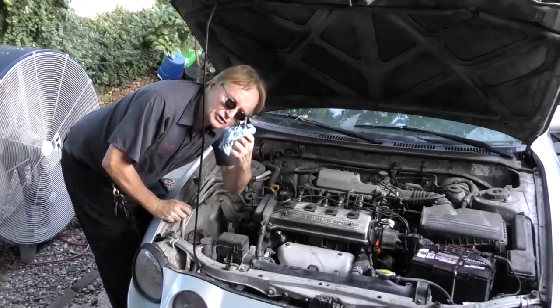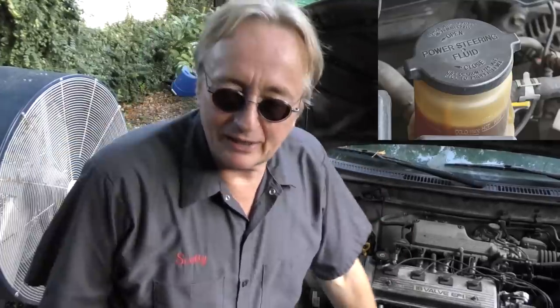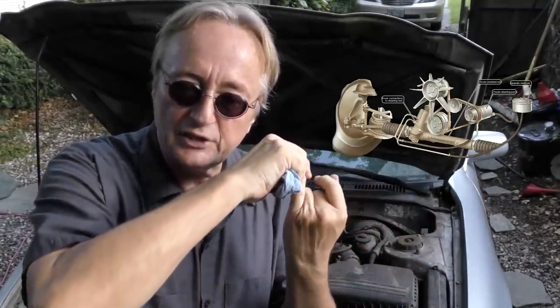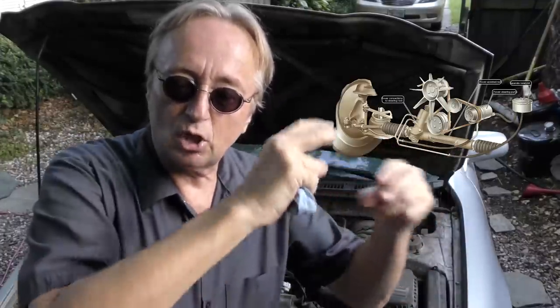If you're not someone who keeps cars for 10, 20, or 30 years, odds are you'll never need to mess with the brake fluid — I've seen them go 7 or 8 years with no corrosion problems at all. The same advice goes for power steering fluid: if you don't drive your cars forever, you can just leave that fluid alone. It does operate at over 1,500 psi, but it takes a long time to get dirty. If you keep them forever like me, flush the power steering fluid every 8 or 9 years, because at that high pressure any dirt acts like a cutting fluid and can eat the seals on your power steering rack, the pump, and cause rubber hoses to corrode inside.